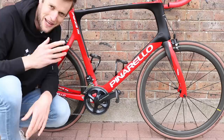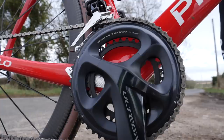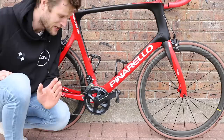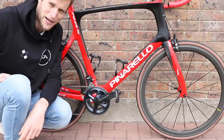Another thing to bear in mind if you're a taller rider — again, us taller riders are a bit heavier — think about your gear selection. I loved to go for a 34 or 36 inner ring at the front. You can get this with a compact chainset and I recommend this for any rider out there. Us heavier riders are always a bit slower on the steeper climbs and I preferred to have an easier gear so I could spin up these climbs a bit more instead of suffering with a lower cadence. Do yourself a favor, give yourself a bit of an easier gear selection. Don't feel bad about it or like you're letting the side down.